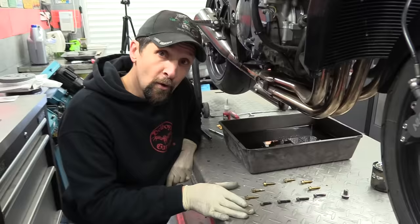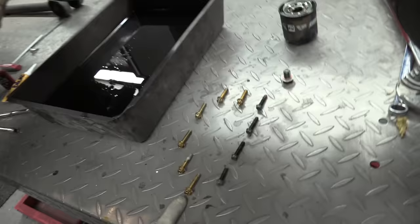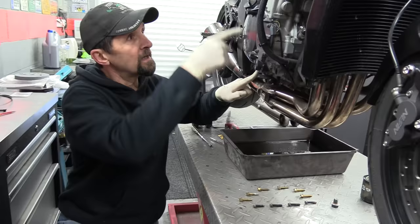Right now, the bolts or screws, whatever you want to call them, that hold that casing on are slightly different lengths. So when you put them down on the bench, you can put them in order. That's the lowest one, which goes right down here in the lowest hole on the casing. So using that as the start reference point, your 6 o'clock if you like, put that at the lowest, then work up the side of the casing, put them in order.